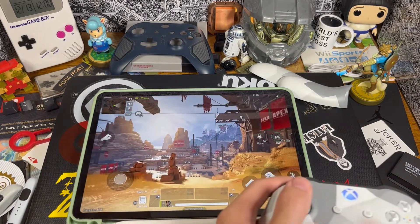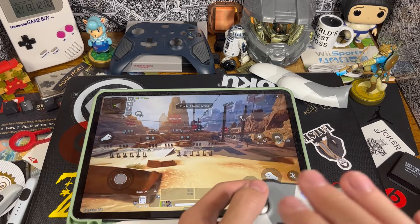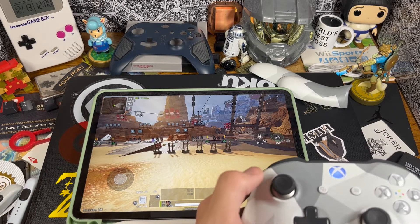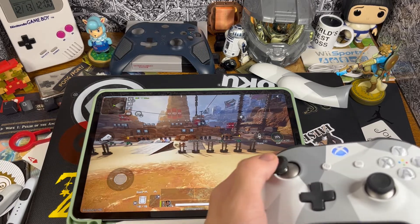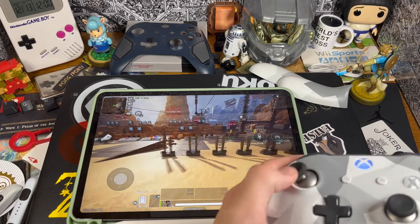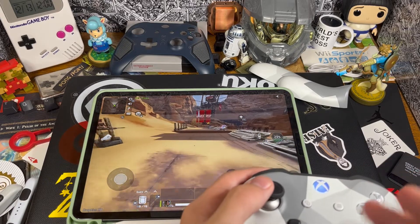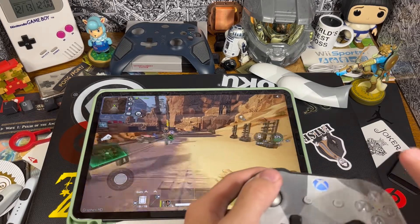I've reopened Apex Legends mobile back in the firing range — same game, same scene as before when the controller was drifting. Earlier, when I moved left, the controller would keep holding left until I flicked it back. But now watch — left, right, up, down, diagonal, all the way around — it works just fine. Popping a little gap between the potentiometer and the stick box gives the sensor a little more wiggle room, and that removes the stick drift.